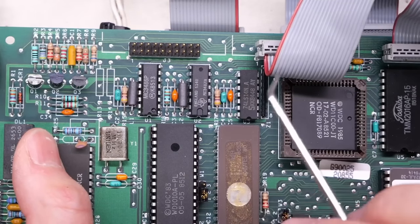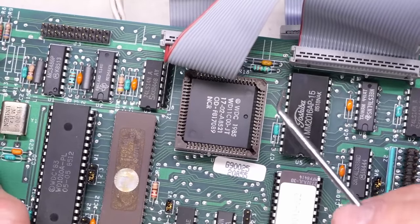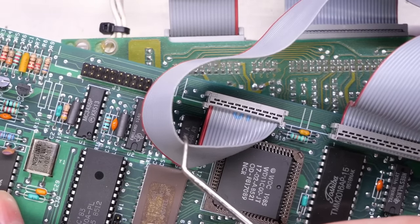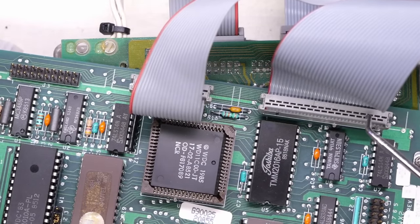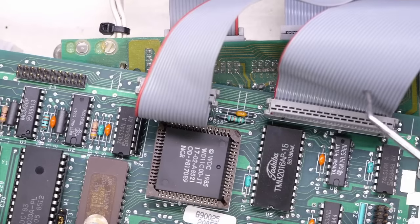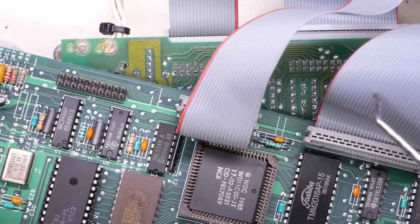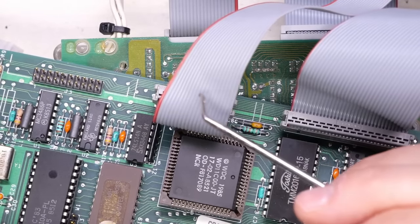Now take a look at the controller. It does have a pin one marked, so the cables are connected that way. This small cable is for the data itself — it uses differential signaling, running at maybe five megabits over this cable. This is very similar to a floppy drive — it's a 34-pin connector that essentially moves the heads back and forth, steps them in different directions, tells if the drive is ready, and has drive select stuff. But this cable is the data itself.